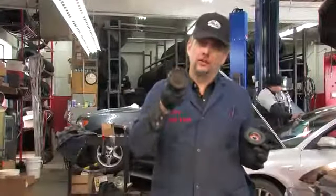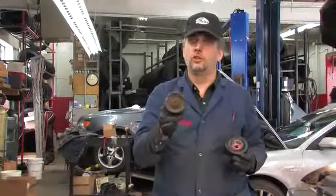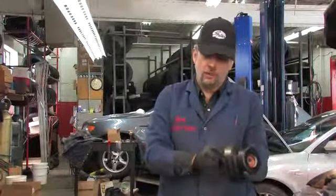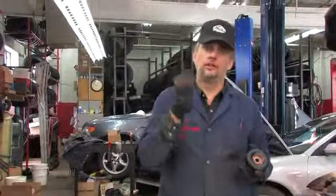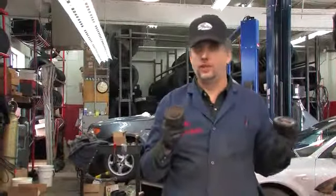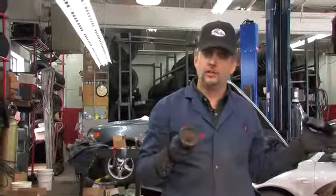I've just removed this idler pulley with a very long Torx bolt and a lot of finger dexterity. And you know what? When I've taken it off, I've discovered noise. The bearing is worn out in this idler pulley. You could not tell that with the engine running externally because of engine noise and because of the howling of the failing bearings in the alternator itself.